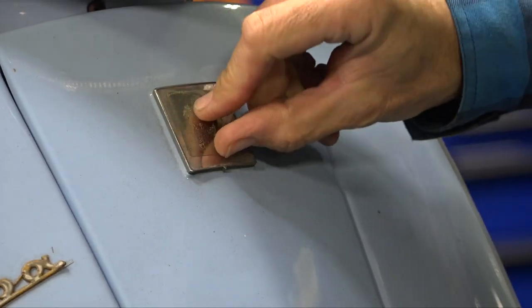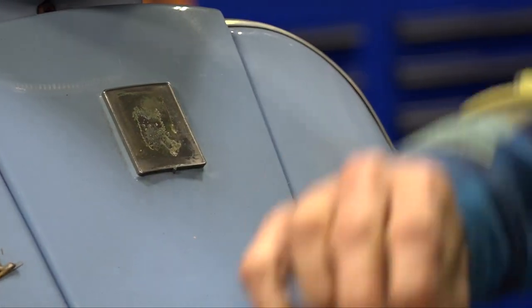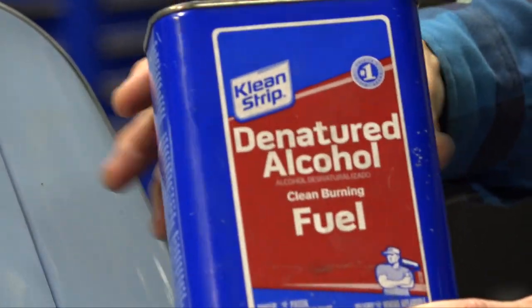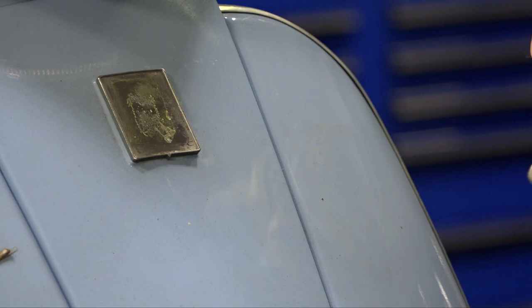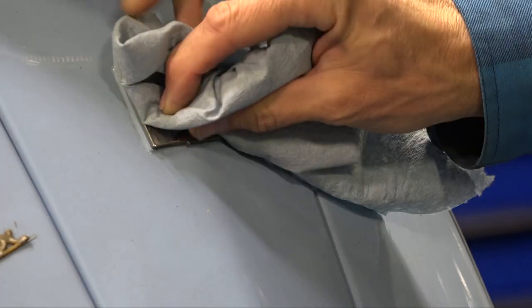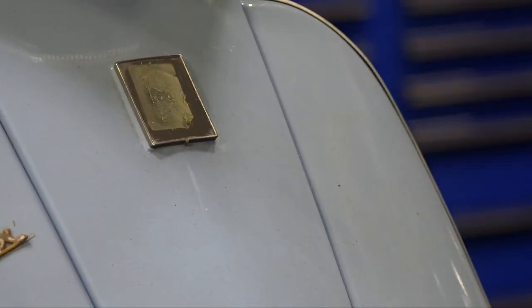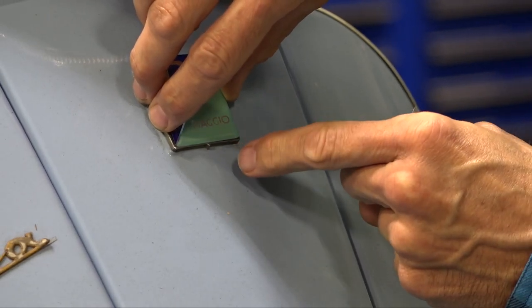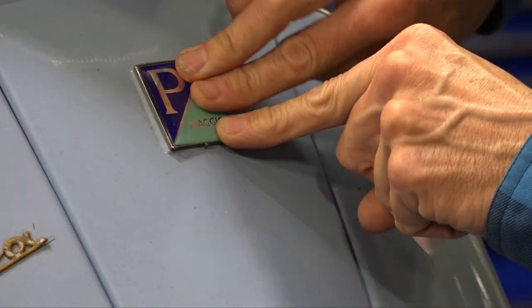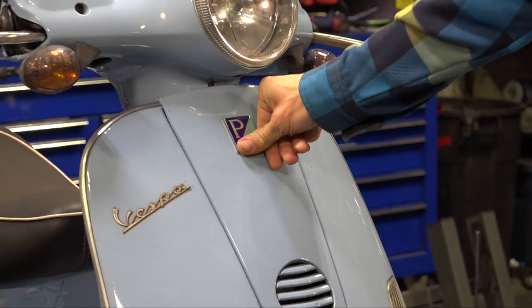There is some adhesive left behind. If you really want to clean it up, the new sticker will stick a little bit better. You can use something like denatured alcohol — it's a good cleaner that's not so dangerous that it will damage the paint, and it will break up that adhesive. Just put it on a rag and wipe that badge down, otherwise your badge isn't going to really stick. Just a small amount — you don't need much just to clean it up. Let that dry a little bit. This is sized to be exactly like the original, so just line up the lower edge and work your way up. Put some pressure on it, and voila — for a couple bucks you've freshened up your Piaggio badge.